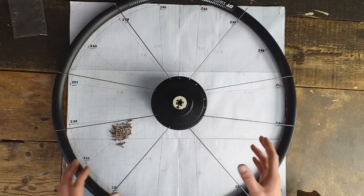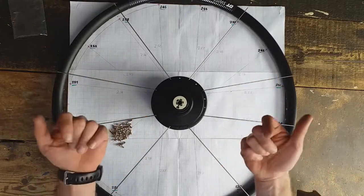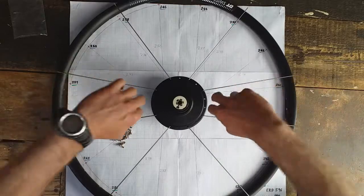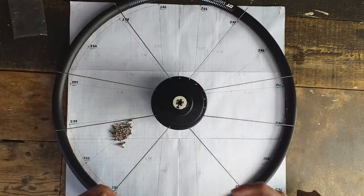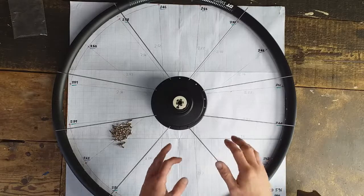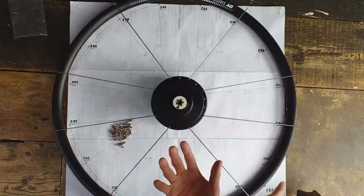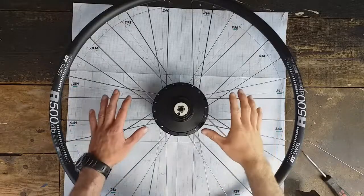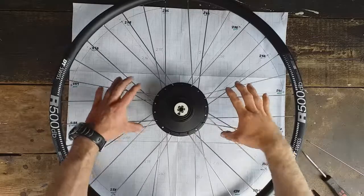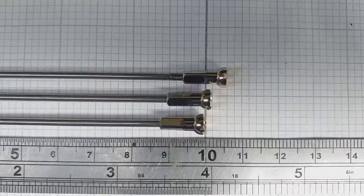What I'm going to do is put all the short ones up through the holes and all the long ones down through the holes, and that should keep it kind of organised and easy to do. Then you need to replicate it on the other side but flipped over and round by one hole. That's all the spokes just loosely in place at the moment, hopefully all with the right cross pattern and so on.